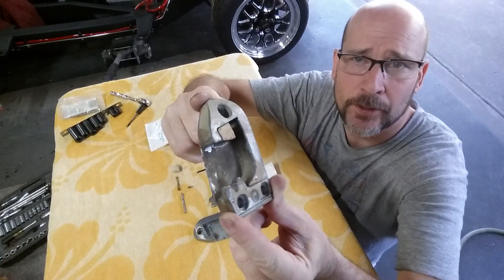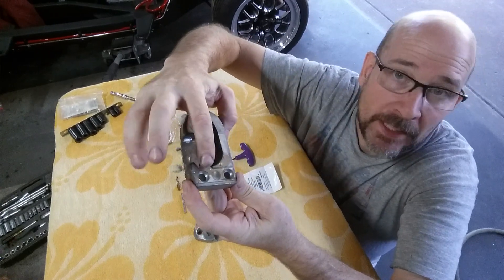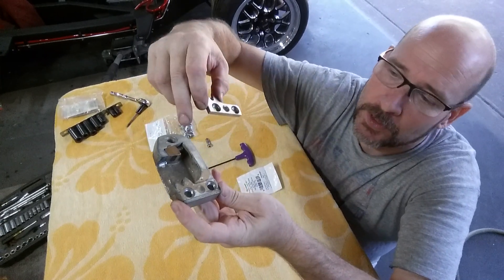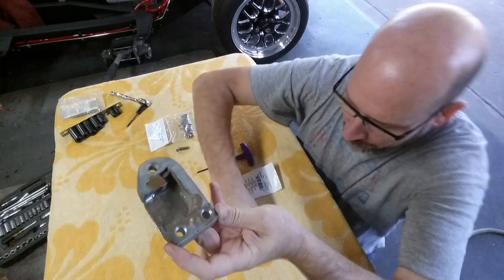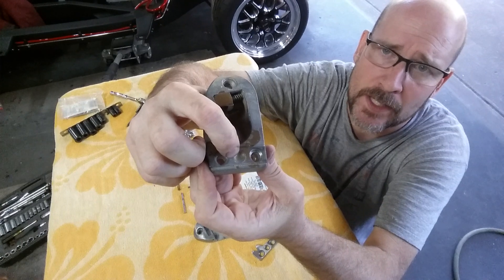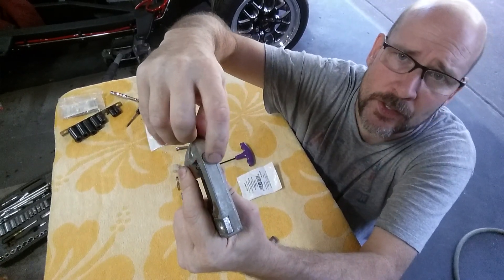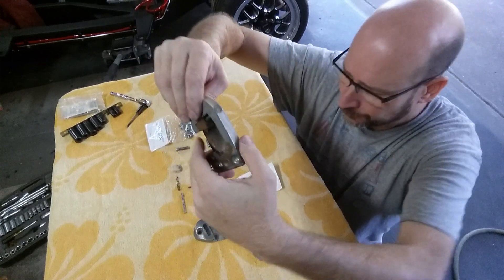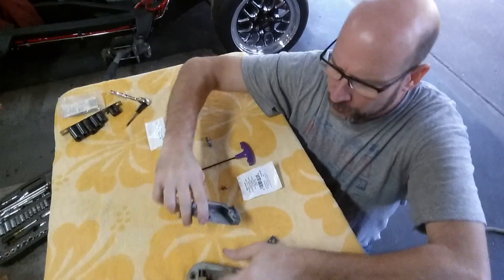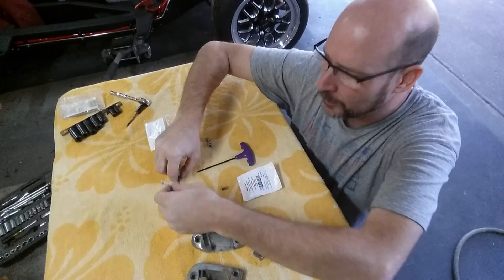So this is what a factory one looks like. They're basically made up of four parts: they have a latch plate, a tooth plate right here — this is actually steel. The whole housing is pot metal; for years I thought it was aluminum but it's pot metal. Anyway, I took a drill bit the same width as that pressed-over pot metal rivet head and drilled it out, then removed the plate. Then I took a die grinder with a cone burr and went around the edge of this pin head right here and knocked the pin out.